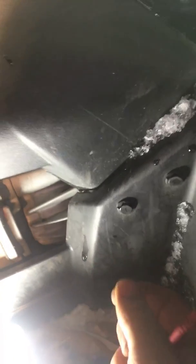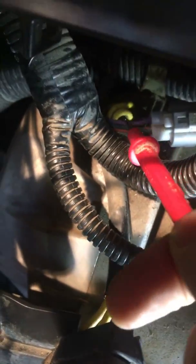Pop these panels off — just one panel — using these little clips. You can wiggle them out with a screwdriver; there's probably a tool that pulls these out nicely, but you can get them out without mangling too much. Pop them out a little with the screwdriver then grab them with some linesman pliers and pop them out. There's also a Torx head on the panel, and that reveals the area where the harness connects to the stator inside the body.